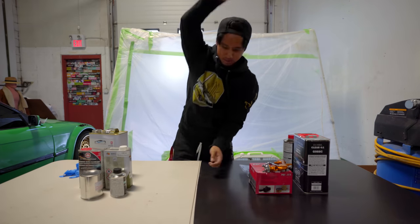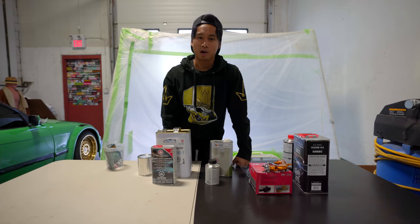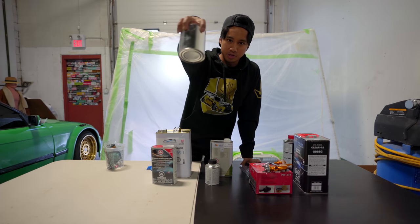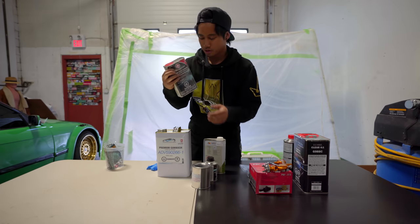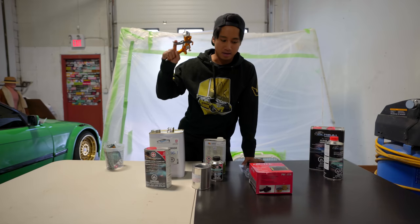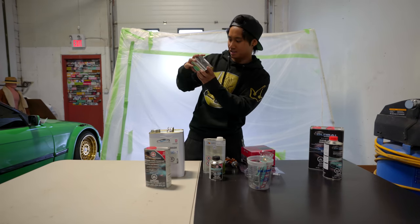Before I get started, just change into something you care a little less about getting paint on. Okay, the supplies you're going to need for this little DIY painting project. Here's all the liquids. Like I said, we've already done the first step which is the primer, and I've set up all of the pieces inside the booth. Still got to clean it up though, wipe it down with isopropyl. The next step is the base coat, which we're going to be using this lightning yellow for. This may not look like much, but it should be enough to get it yellow yellow. So you got the paint, you got reducer, we have the urethane clear coat, and then the activator for the clear coat. Between coats, you want to wash your gun properly so it doesn't get all the gunk left in there — that's what this cleaner is for. Then you're going to need an actual weapon and protection: a mask, paint gun, and everything to mix it in. That's pretty much it. I'm just going to get the compressor and the gun set up, and then we can clean the pieces and finally get to painting. I'm so excited to see what this looks like.